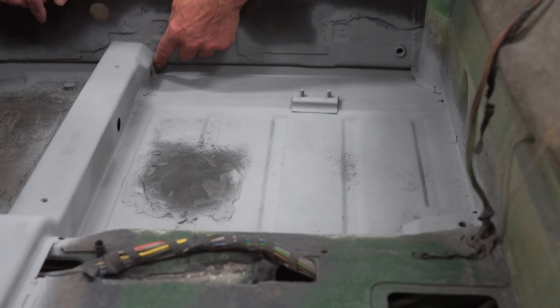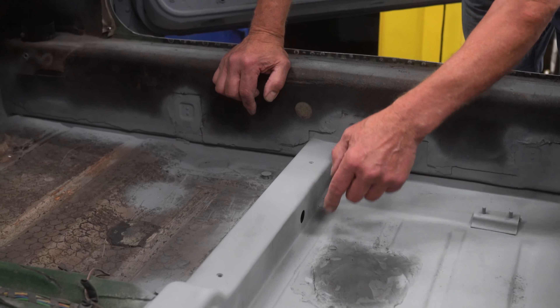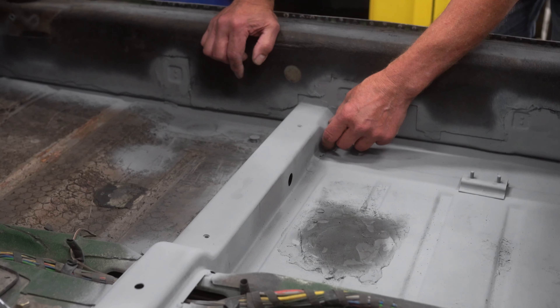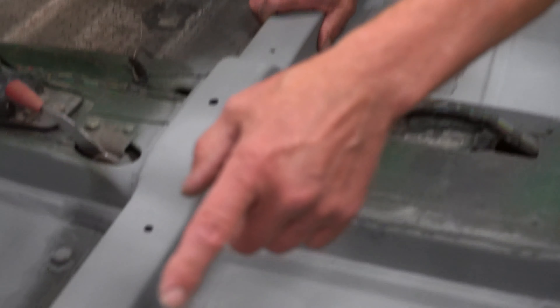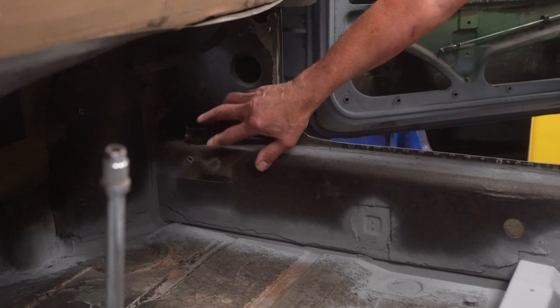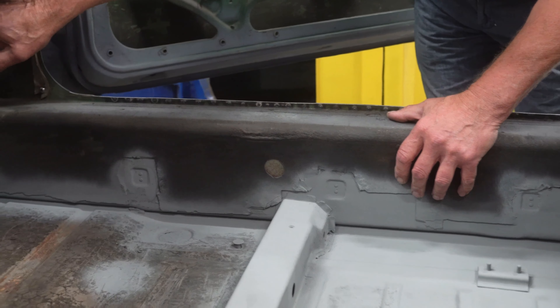One easy way to tell that you've got a 70-71 car is the affixed seat. There are no hinges right here — just permanent brackets to bolt the bucket down. These can be fabricated with bolts and sheet metal if you want to backdate your car. Many people like the adjustable seat, so they ended up taking these out and putting an adjustable seat in the 70-71 model. The sixes especially need to go back to their factory original perfection, so it's very important to weld these in and get rid of the movable seat. The bumps in the crossmember here were actually for the emergency brake switch — maybe Porsche had planned to come up with a right-hand drive model. The port here is where the heat comes through the longitudinal, and inside here is a muffler going into the ventilation system.